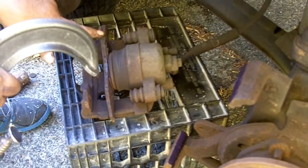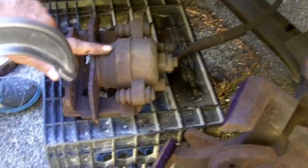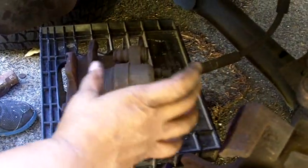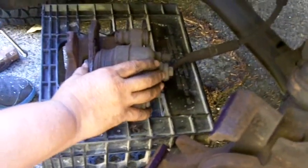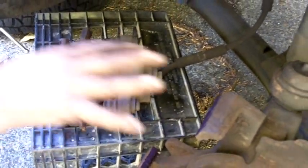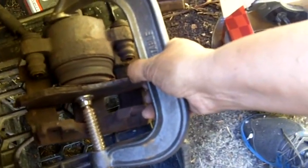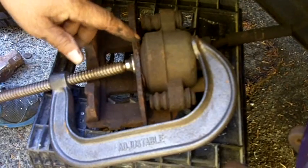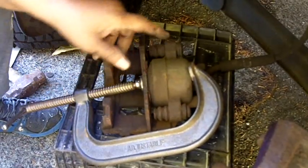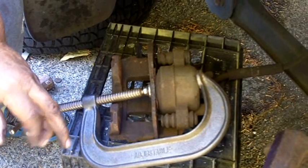Before we remove the second brake pad, this is a piston here. That piston closes and collapses, then opens as the brake shoes wear. If I don't close this piston up, we won't be able to get the caliper back on the rotor. We leave this brake pad on, take a C-clamp, and tighten it up slowly to depress the piston. Once the piston is depressed, you can remove the C-clamp. Also, when you start depressing the piston, it shoots brake fluid back through the line up toward the reservoir — remember I had you take the cap off the reservoir. Just keep your eye on it because you don't want it to overflow.